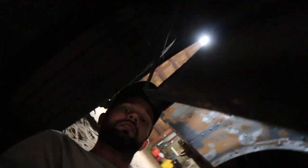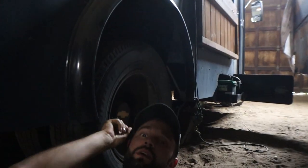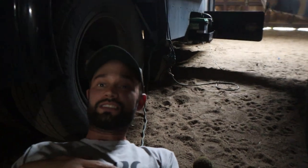I just got everything programmed and my phone's just sitting up there doing some updates. The next thing is getting the alternator wire in. This wire, which we ran a long time ago, now has to go above the wheel well, tie up into the frame, and then up to the battery — connect to the positive on the battery — and then we're good to go on the Orion charger. That's going to input 360 watts from the alternator into the battery bank, which should definitely help us out. Once we get that in, then it's just the AC-DC panel, and then we will see the lights that we turned off a while ago turned back on inside the bus.